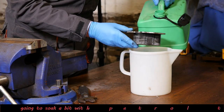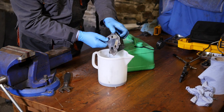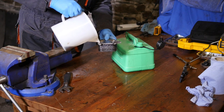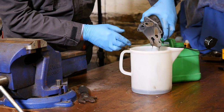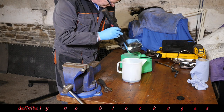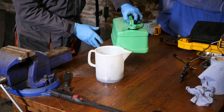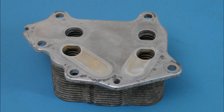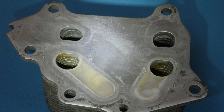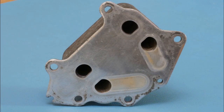Finding this actually clean, I'm starting to think the car has probably been serviced quite well and the oil has been changed regularly, which makes it a little bit more confusing as to why the top end has gone. I've put petrol in there and let it soak to see if we get any little bits of debris — there are a few little bits, but there's definitely nothing restricting the flow. Here are some photos showing the oil cooler now it's been cleaned up — it is like a stack of plates that are separated, so you can see it could clog quite easily if neglected.